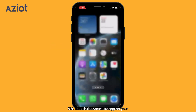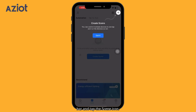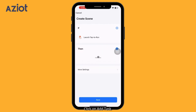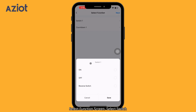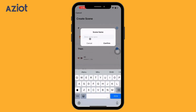For integration with Siri, launch the Smart Life app on your device. Locate the bottom navigation bar and tap the Scene icon, then select Create Scene. Choose Launch Tap to Run, click on Add Task, and choose Control Single Device. Select the AC. You will come to the Select Function screen — select Switch One and then click the On option. Save it, go to Next, and then Save. Assign a name to your scene that reflects its purpose; this name will be your default Siri trigger phrase. In this case, it will be: Turn On AC.